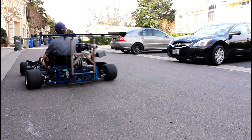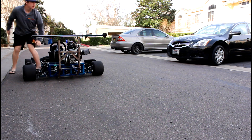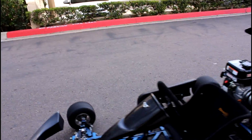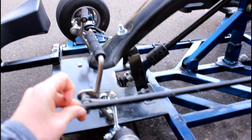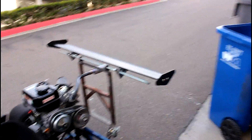I was driving down that side of the road there and the brake feel suddenly got really light, and then I realized I had no brakes. It was just because the nut that held the brake rod on slipped off. So basically I've got to find a nut to go over that or find the nut that fell off, or else it's going to put a premature end to our testing day today.